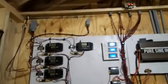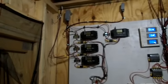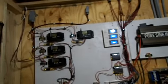Going back to see what the voltages are, just for the heck of it. Charging at 28 amps, 31 amps, 33 amps. I can't get back there to press the little buttons to see what's doing what. We're at 13.6 volts, 13.59.